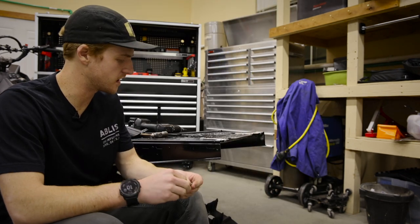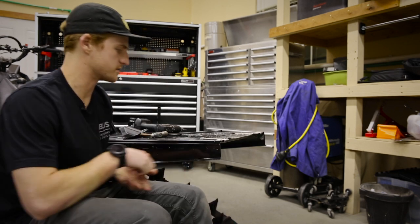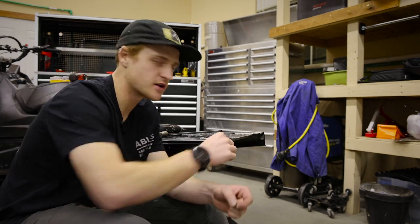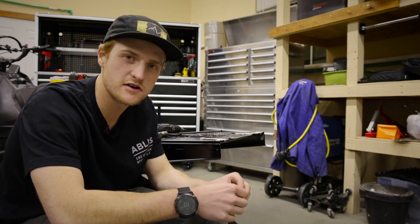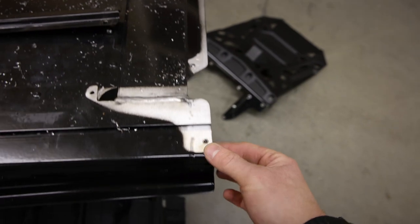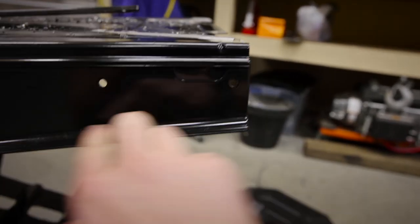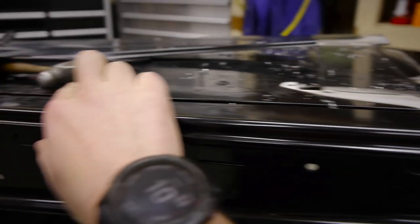Once you have the snow flap bracket removed, you can see what I'm talking about much better. Please don't cut through the weld — just don't risk cutting into the weld and putting a hole in your cooler. The whole reason we're doing it this way is so we don't have to cut into the cooler. We're going to remove this tab, remove this edge, and cut through this last bumper hole right here. We'll do a little work here, drill a new hole, and if you want to reattach your taillight you'll be able to do that.